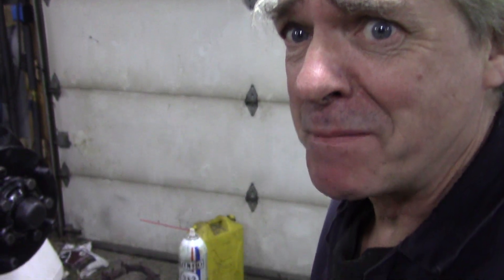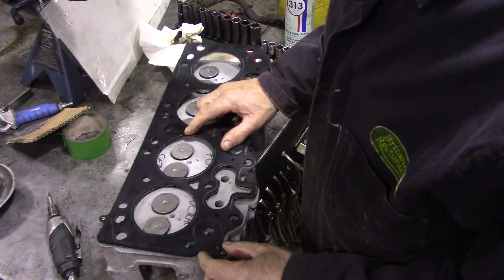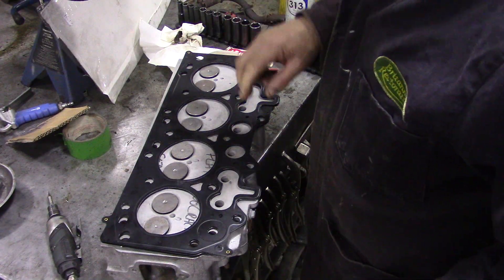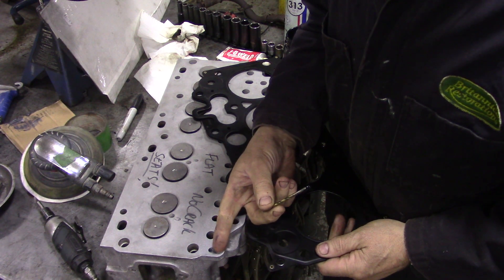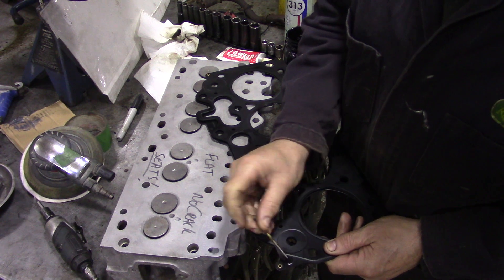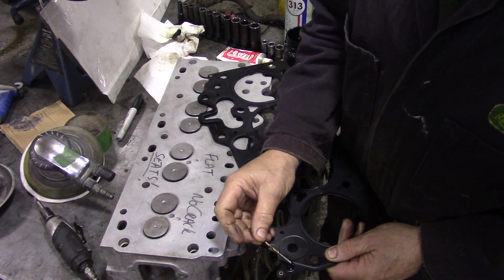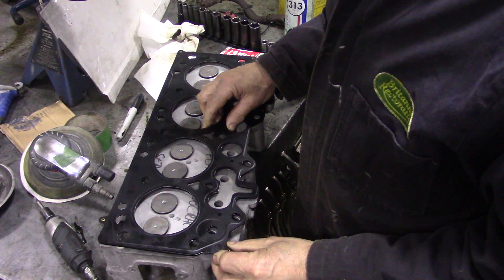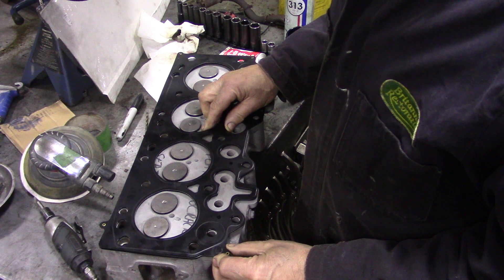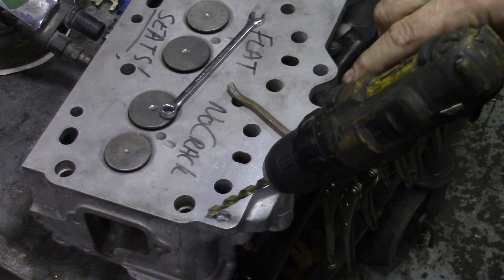Right, this is the next day and I think I might have made a bit of a mistake here. Should that hole be here? I'm thinking I've put it in the wrong place. So I'm going to put some black paint on that raised portion where the hole is, then put this on and see where the hole lines up. I thought about this last night and thought, oh sugar, I've put it in the wrong place. But it doesn't matter because we can always dig it out. That's where the hole is — and that's why they need the slot. The hole comes out at a kind of a sharp angle, and they've put this little trough in here to pick up the hole on the original casting in the block.